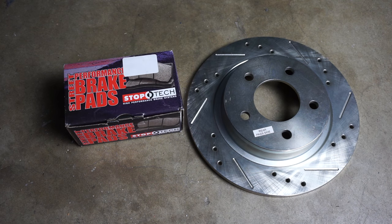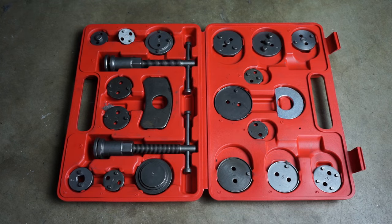The parts we're using are these Power Stop slotted and drilled rotors as well as these ceramic brake pads. There are quite a few tools we'll be using for this project, so if you're interested in a full list just see the video description below. The main thing you'll need though is a brake caliper tool kit. This is important because rear calipers require that you spin the piston while compressing, which is different than a front brake caliper which usually only requires compression. It's also considerably harder to compress, so this tool will make your life a lot easier. We were able to buy this entire kit for $25.